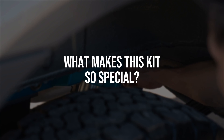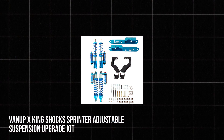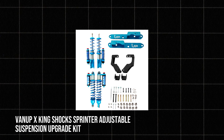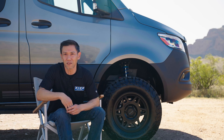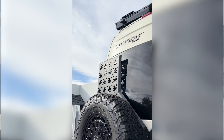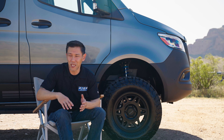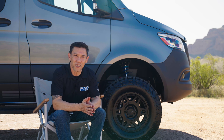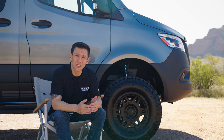We have a couple of kits for Van Up. The first one is the standard coil-overs — the struts — that include a rear coil-over kit. The rear is going to be a 2.5 shock coil-over with piggyback reservoirs and short fin reservoirs. The benefit of that style shock package is for vans that are pretty heavy in the back; it helps carry weight better and maintain ride height. It's also much easier to swap springs on that setup, and you can set your preload to fine-tune your ride height in the rear.